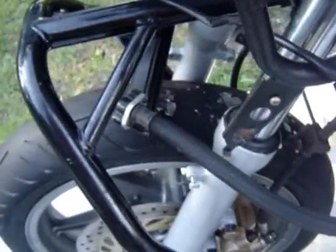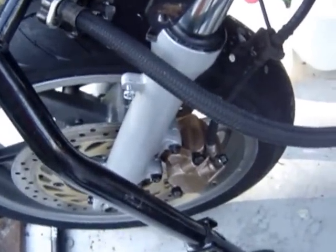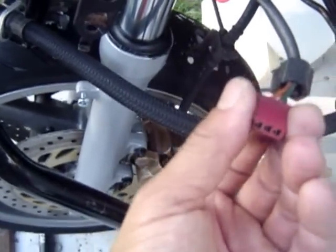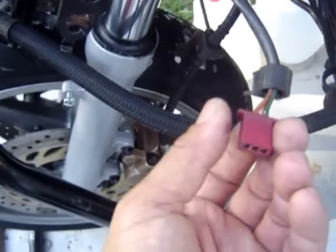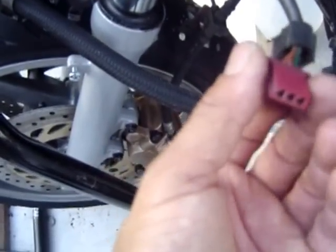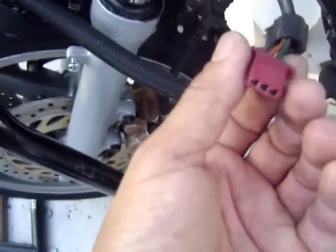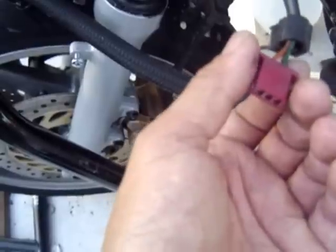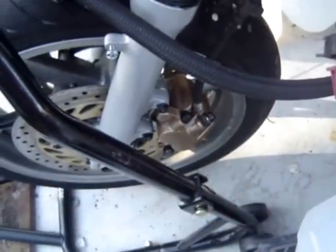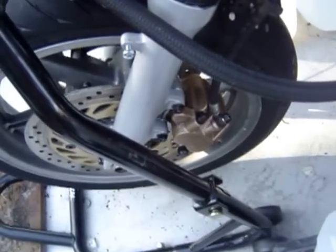That concludes the wiring harness and running lights — the same goes for the back. You may want to take a piece of paper and write everything down, but it all starts at the signal relay. Check everything and the corrosion on there. It took me almost a week to figure out what was going on. I got irregular or various measurements due to the corrosion — the corrosion was the problem.